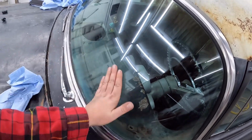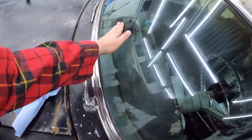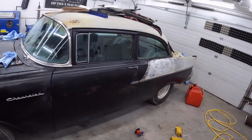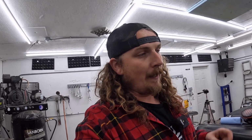It does feel a heck of a lot smoother. So I'm sure enough elbow grease from Murr down the road, he can get that figured out. And I think next time you see it, we'll have the rear wheels up in the air and we'll try and pull the center section out, see what gear set we have, and go from there. It's a bit ugly, you gotta knock the axles out, which they can be a bear. So we might end on a win or a fail, who knows?